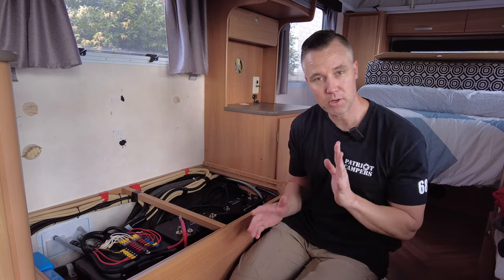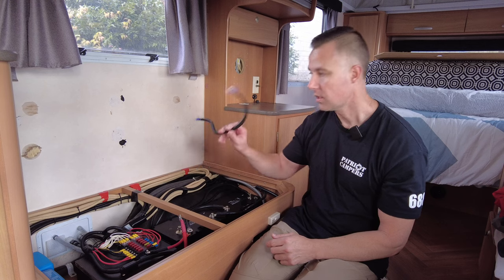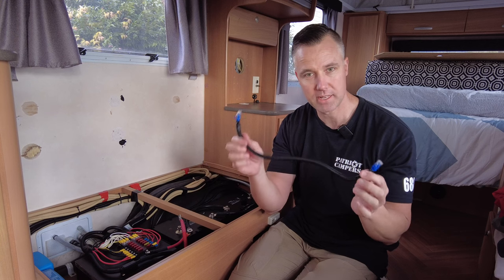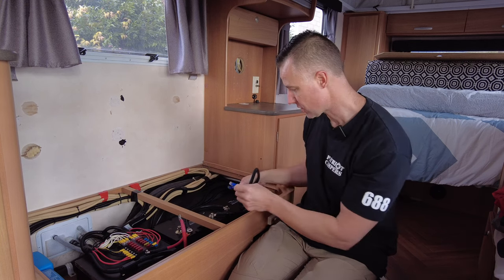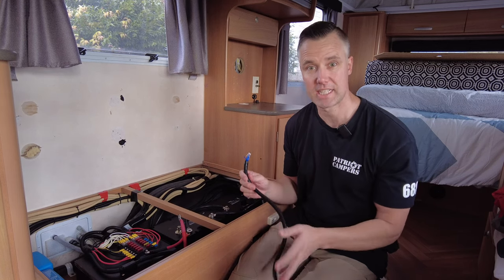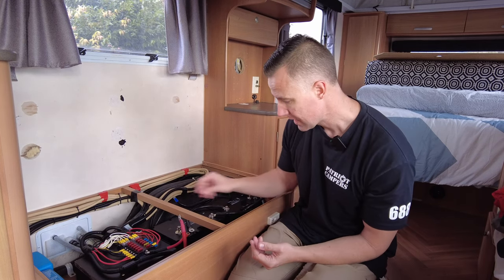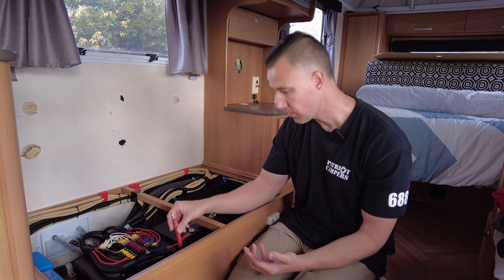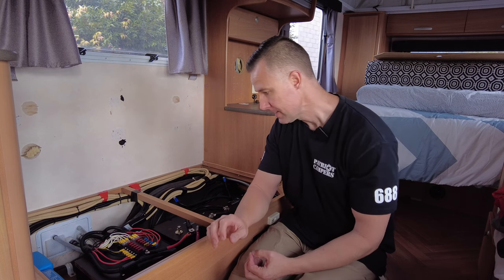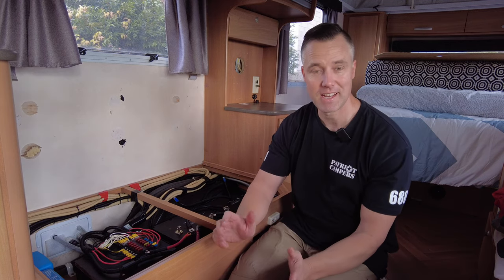I've run that battery monitor cable and wrapped it in conduit to protect it. I've also got the linking cable — just an RJ45 cable you purchase separately. This plugs into each of the batteries and gets the battery management systems talking to each other so it recognises there are two batteries. We've still got to do the main battery connections, connect up the inverter, put the fuse in, wire up the solar regulator and DC-DC charger, and then we should be right to get some power and start testing the system.